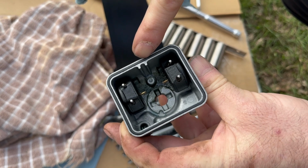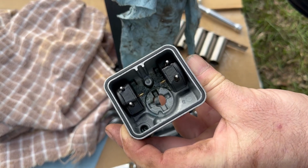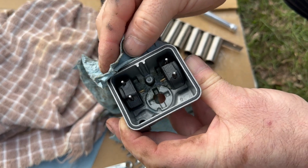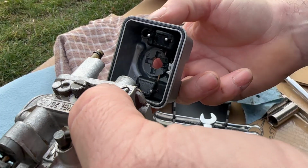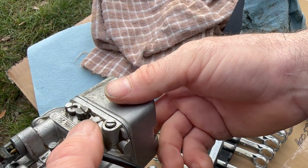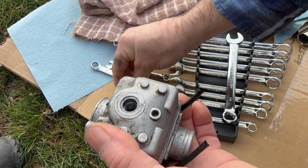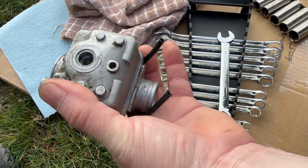This is an O-ring in the float bowl of the carburetor, so you can take it apart and use it many different times. This is a common problem I've had with this bike. It uses a 2-stroke mixed fuel, and when the fuel dries out in the carburetor, it leaves a gooey, sticky residue, and that glues the float shuttle valve shut.